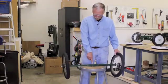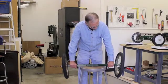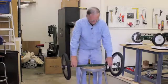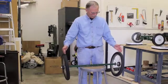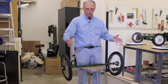In the early days it was a solid axle, but later the axle became fixed and doesn't tilt, because you have a lot of mass plus geometry issues you can't get around. When you tilt a solid axle, both wheels assume the same angle, and as you turn, the wheels tend to plow, slip, slide, and grind.